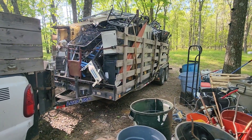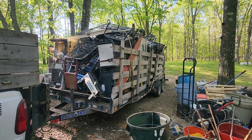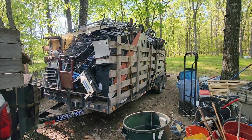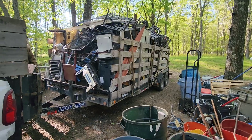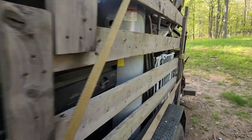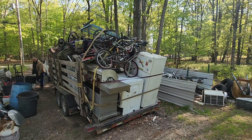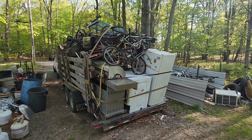I see some of you guys pulling trailers like this with minivans, small SUVs, transit connect vans with water heaters. I'm calling one guy out — that thing is only rated to tow 3,000 pounds and he's using a car trailer. It takes a lot of nerve to tow that with a transit connect van. If your truck doesn't have a seven-way connector, you probably shouldn't be towing six to eight thousand pounds. Older Fords, Chevys, Dodges, and Toyotas didn't have the seven-way plug adapter or a built-in brake controller like my truck does.